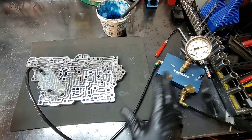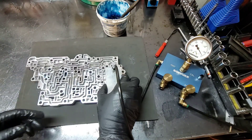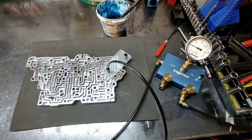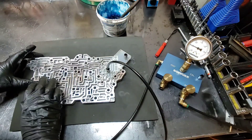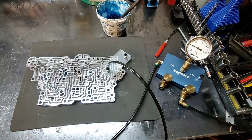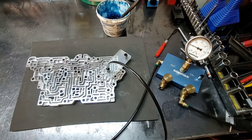That's just a basic testing on this kind of deal. This is my best one right here — look at that, it immediately goes up and I don't even have to press on it. There you go, guys — 6T75 Gen 2 accumulator dampeners or solenoid dampeners tested. Look forward to the 6T75 Gen 2 valve body diagnosis on the one with no reverse and no gears 3 through 6.